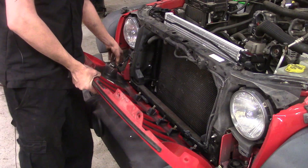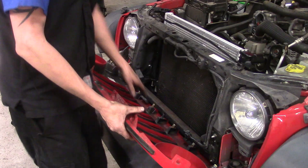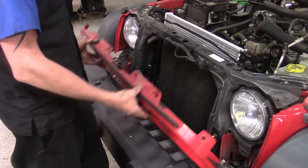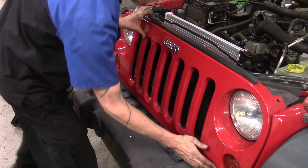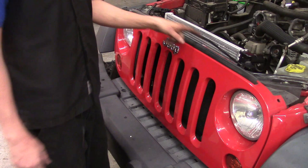At this point it's time to put the grill back on. Sitting it in place, we'll go ahead and reinstall the lights into their respective sockets, rotate them and lock them in place. There are snaps along the bottom — the shiny things — that need to line up with the little rectangle holes. There's also a guide pin right here to keep everything centered. Get a couple of firm pops and just go down the line snapping everything in place. Then install the total of six plastic push-pin fasteners and your radiator grill will be back in place.